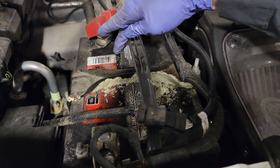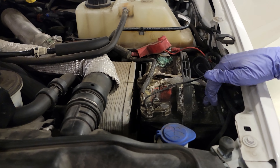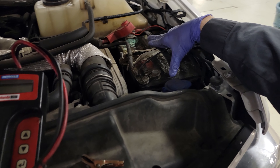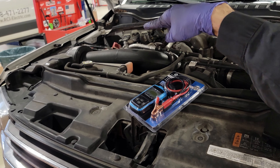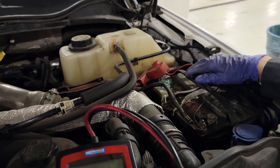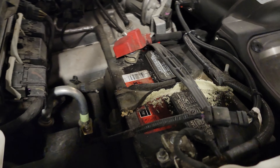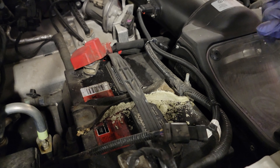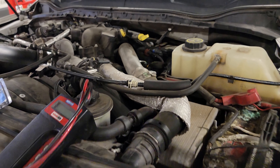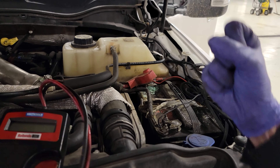If that comes in looking like that, we're going to want to replace those batteries. Always — if you have a diesel — always get in the habit of replacing both batteries together. I've had an instance where we had a good battery on one side and a bad one on the other, and that bad battery leached the voltage from the good one. The vehicle was still having battery and electrical concerns. So if you're asking do I do one or two — do both. And get decent batteries; you pay for what you get. Our diesels have high compression plus all the electronics and modules that need power the moment you turn the key — battery voltage is crucial.